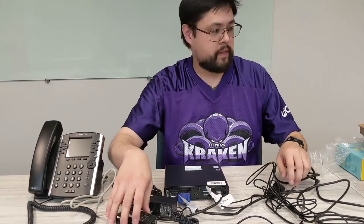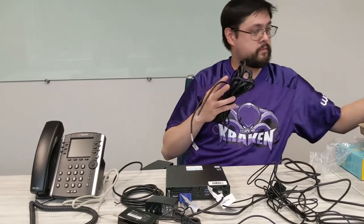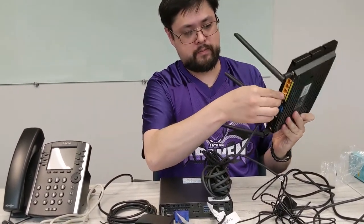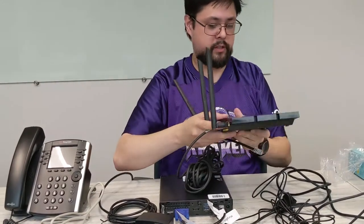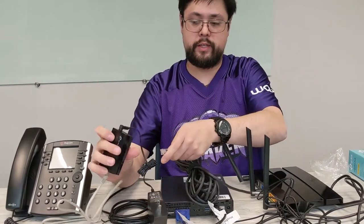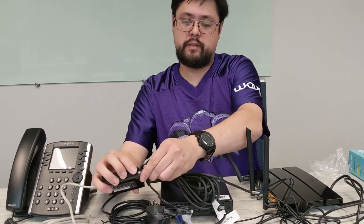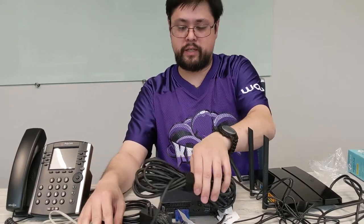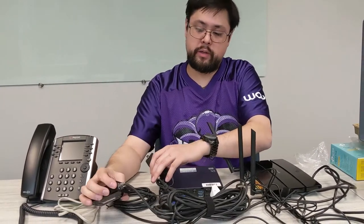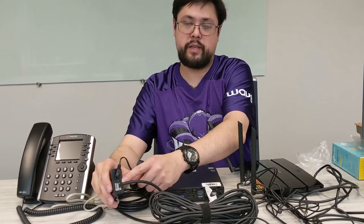To get the internet connection working, take the cable that you have going from your home router, from one of the yellow ports on the back. Make sure it's nice and firm in there. Then the other end will go into the power over ethernet injector on the same side where you have the power supply connection — it's going to be LAN in. Once that snaps in, you'll have a pass-through connection. It's only going to work if it's plugged in and has power, and when it does, you should see some green power activity on the injector itself.